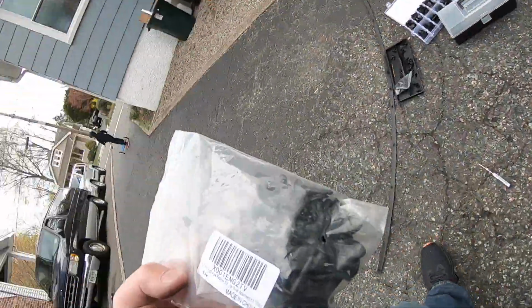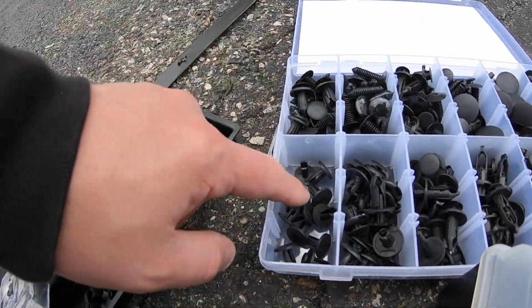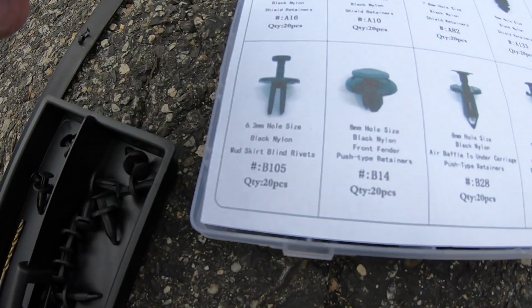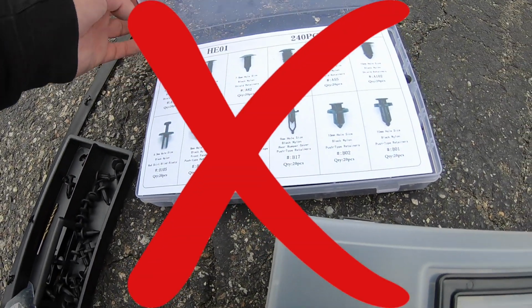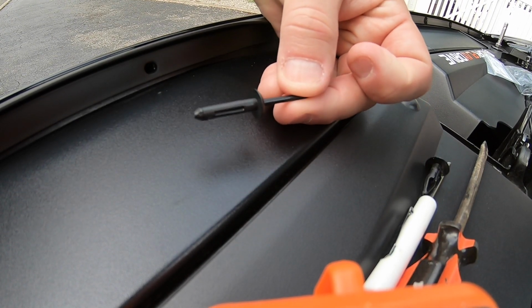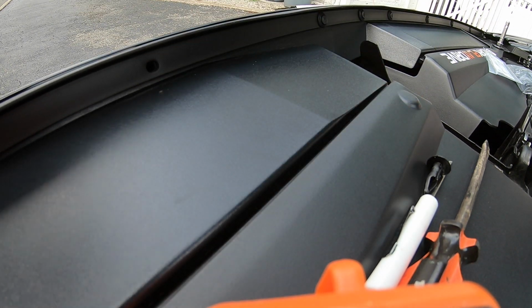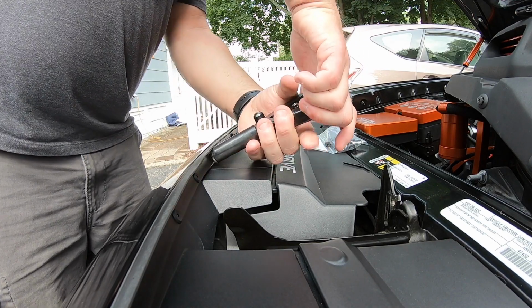When you're placing your order for the seal, you also have to head over to Amazon and pick up the proper nylon rivets. I have what I thought to be every size clip and rivet imaginable in my bins, but I was amazed to find out that none of them worked here. The rivets needed are relatively long, as they need to go through 3 layers and sandwich the nose and the seal in place. I've got a link to the Chrysler 3/16 nylon rivets and a good but inexpensive plastic rivet tool in the description below.